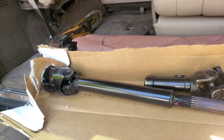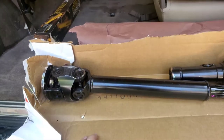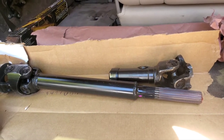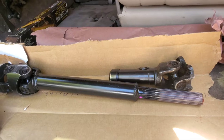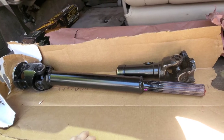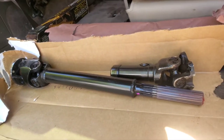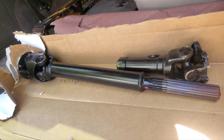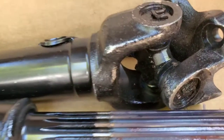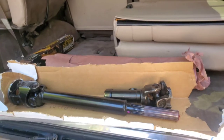I'll try to replicate the noise — at 50 miles an hour you start to hear that vibration. The double cardan gives you two U-joints, which helps with the angle. Even though when you go from stock to the lift you're changing that angle, you still need the help of a double cardan. Curtis has been in the business — his grandfather, his father, and then him — about 75 years between the three of them, so they know what they're doing. Love it. Let's get on the road and see if we can replicate that noise.